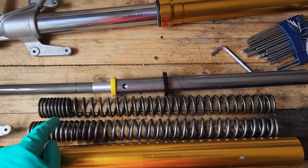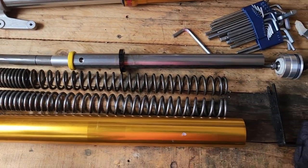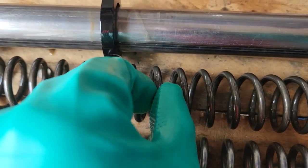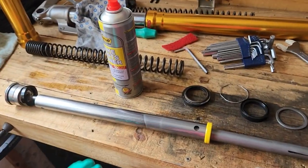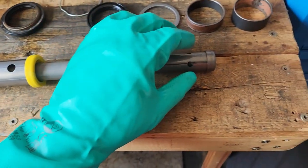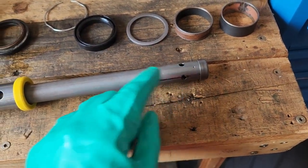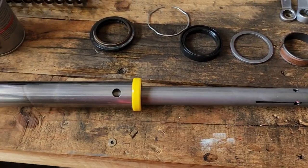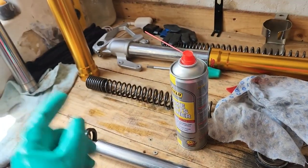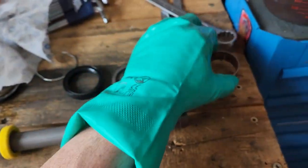Side-by-side comparison — Hyperpro versus Triumph. Triumph is sort of linear, but at least there are no metal half-spacers in there. Disassembled and cleaned — the internals are real simple: this slides off, this little cap can also be removed, it's loose so don't lose it. A lot of crud around here; basically every metal surface was coated with black stuff. Easiest way to clean it — run a broom handle through here with a rag, same with the tubes.